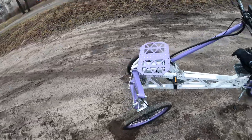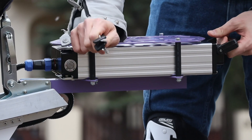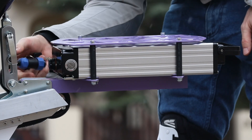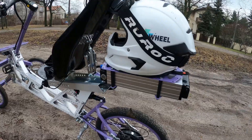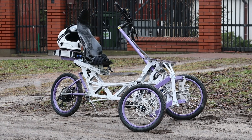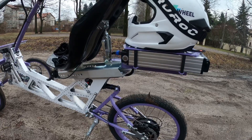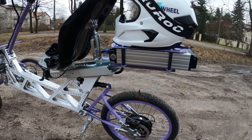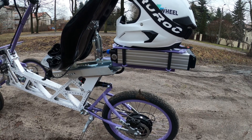When it comes to specs, it has a removable battery in the rear which is pretty enormous for a legal e-bike — 900 watt-hours. I believe anywhere between 70 to 100 kilometers of range should be possible. It's also removable, so it's really convenient to leave the recumbent somewhere and charge it at home. The recumbent comes in two versions: this one with 900 watt-hours, or a bigger 48-volt version with 1,200 watt-hours, which will get you further and have more top speed.